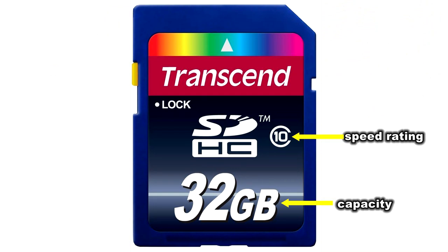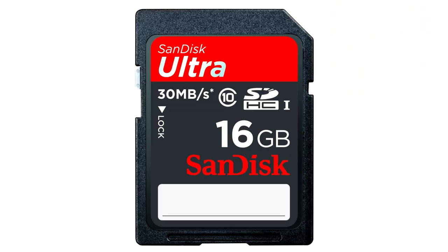The size of card will depend on how many photographs you want to store or how much video you want to shoot. If you bought the camera in a brick-and-mortar store, the salesperson probably tempted you to buy a 32 gigabyte class 10 card. These are ideal if you're shooting extended periods of video at the highest AVCHD codec. If you're just going to be using MP4 because your computer won't edit AVCHD, use a class 10 card but 16 gigabyte is sufficient.